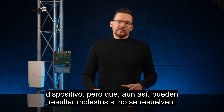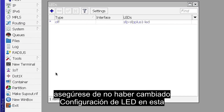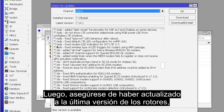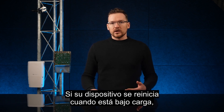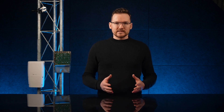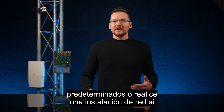When one or multiple LEDs are not working as expected, first make sure you have not changed the LED settings in the System LEDs section, as it is possible to turn them off altogether. Then make sure you have upgraded to the latest RouterOS version, as software changes can sometimes impact LED behavior. Reboots are usually not caused by hardware defects — if your device is rebooting under load, it could be a power supply issue where it cannot provide high enough wattage. Make sure you have upgraded to the latest stable RouterOS version, and if reboots persist, try resetting the device to defaults.